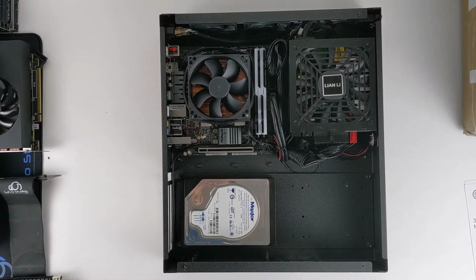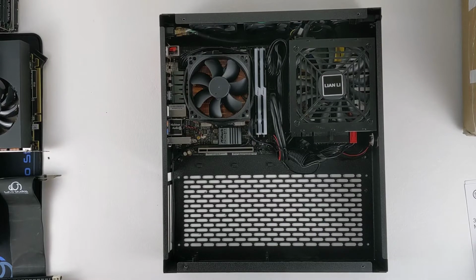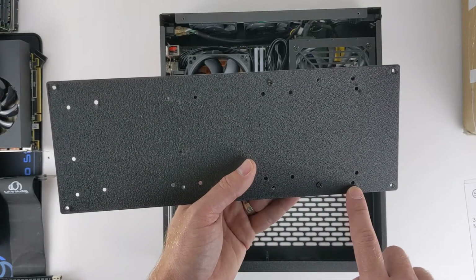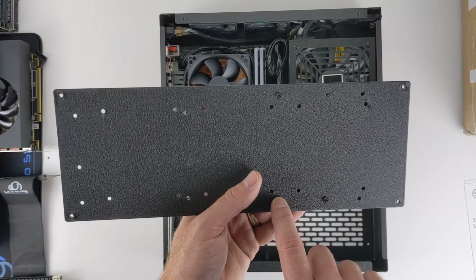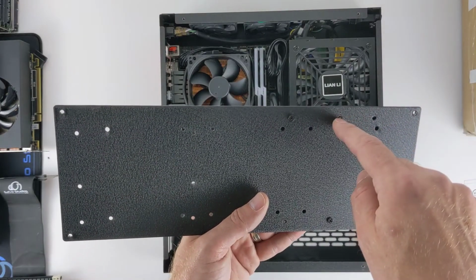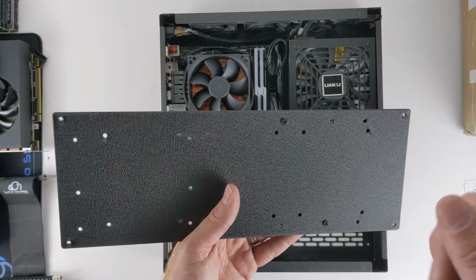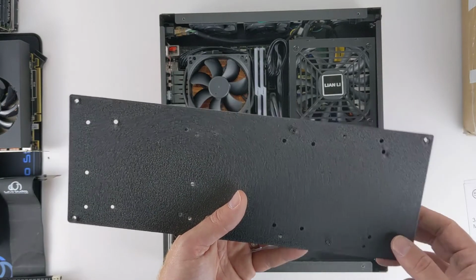You know the orientation, you've got some of the configurations and the dimensions for supported hardware when you go to use these brackets. The last thing I probably will mention is these 3.5-inch holes are supposed to be 6-32 screws, and I include 4 3.5-inch drive mounting screws, but these holes are actually pretty tight after the paint was on, so you may have to torque them down a bit. I would recommend screwing the screws in through those holes without the drive, and that'll open them up a little bit. It may even hold the screws in, and you can just line the screws to the holes on the drive, screw them in, and you're good to go.